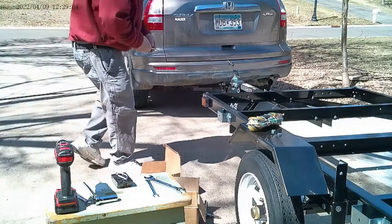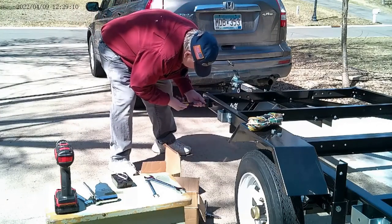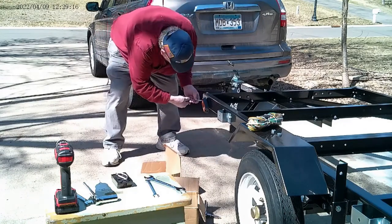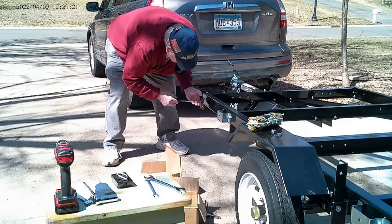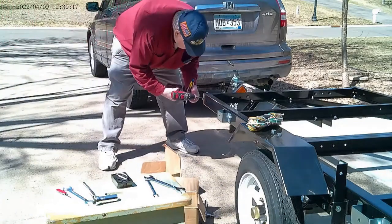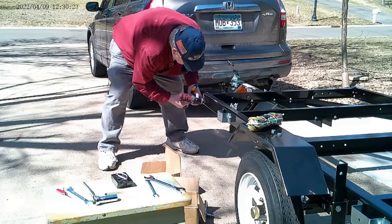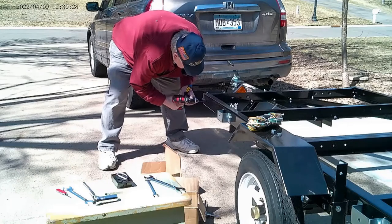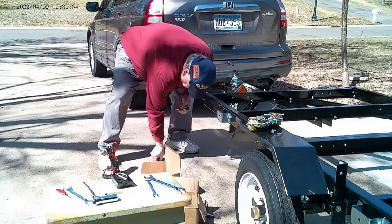Here we're going to start the wiring. I tried putting on the amber light there — they're self-threading screws that hold them into the frame, but after they painted the surfaces the holes get a little plugged up and the self-tapping screws won't go in. If you really force them, you're going to strip or break the screw head off. So just take a little drill and clean out the holes, then run the screw through there prior to putting on the lights. Clean them out and it works just fine.